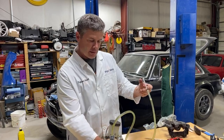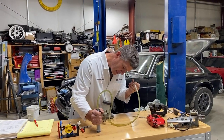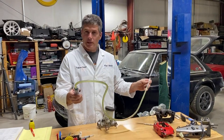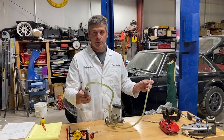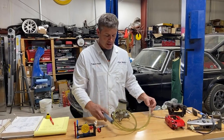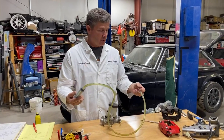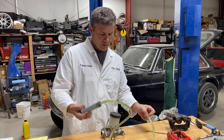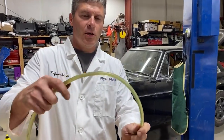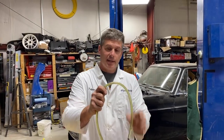That's basically what we're doing — I can't hold this big piston down, it just keeps going up. This demo isn't working perfectly because there's some air in the lines. This is why we use hydraulic fluid: liquid is effectively incompressible, it won't squeeze under pressure. Air does — that's what compressed air is. You can't use air in a braking system because when you put all this force in one end, the air just compresses without doing any work on the other side. If you boil your brake fluid you get air in your brakes, your pedal goes squishy, and all that multiplication just compresses the bubble.